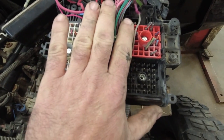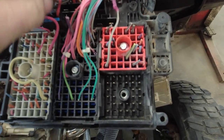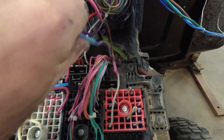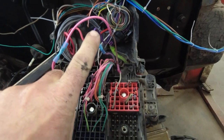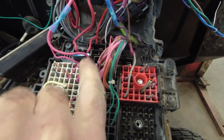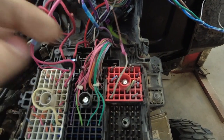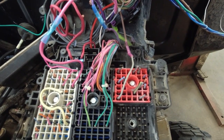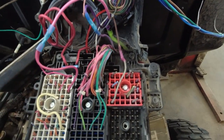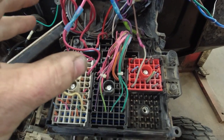But in here, when I said I didn't touch anything, I actually did cut the purple wire, which is for the starter. So I snipped and put that to my crank on my key. That's the only wire that I touched out of this bundle in the middle here. And then this one's like my fuel pump. I hope that makes it clear as mud for people. For this particular harness anyways. Anyways, back to the video.